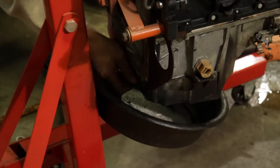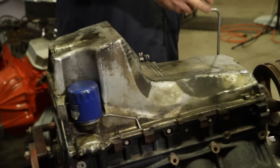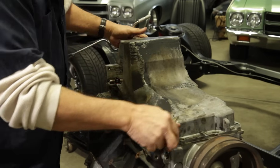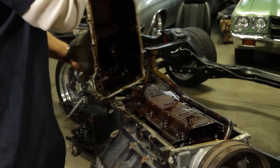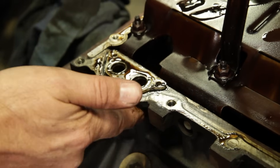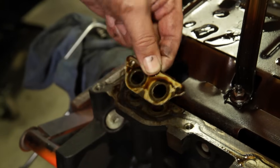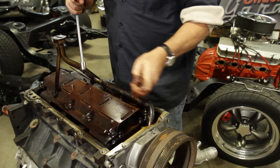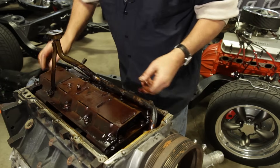It's time to get our hands dirty. Before we can install the new oil pan from Holley, we've got to take the old one off first - get all the perimeter bolts off and then gently pry it up and out of the way. You may get lucky and reuse the old gasket, but in our case we just weren't able to do that. It left a portion of the old gasket right here - this seals up the feed lines for the oil filter. Obviously we're going to need a new gasket. Now that we've got the oil pan out of the way, we can remove the stock pickup.